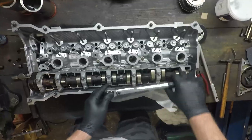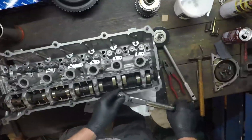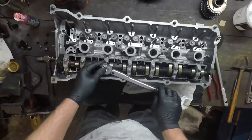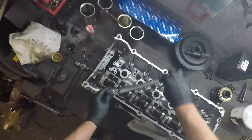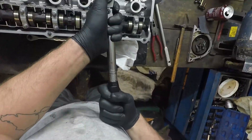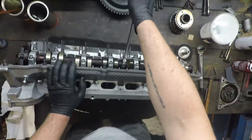That's pretty much the process done. The one thing I'd suggest: once you've got it all tightened down and torqued, take a 24 or 25mm spanner, put it on the hexagonal area on the camshaft, and turn it — make sure the head is on a couple of blocks of wood so the valves don't touch the workbench — and make sure the cam rotates freely without binding. If it is binding, take the caps off, have a look and see what's going on. Don't put it in the car and try to start it without being absolutely sure. That's all there really is to putting the cams in — let's get on with the rest of the process in the next video. Thanks for watching, Paymo out.